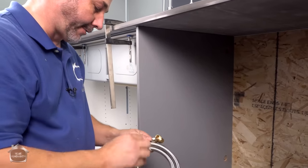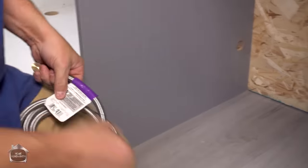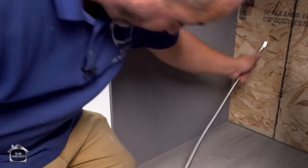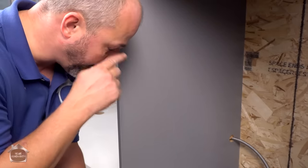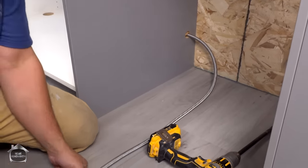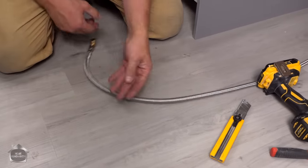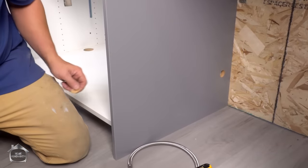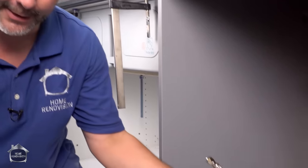Okay, so let's separate the wheat from the chaff here. I'm not a big fan of having stickers laying around, so there we go. Now, the trickiest part about this is that the hose goes through the hole at the bottom of the cabinet and connects to a water shutoff valve just on the other side. The hose itself is only so long, and the dishwasher has a track system — but this doesn't want to play ball. So what you want to do is drill your hole a little bit bigger than you need — I want an inch and a quarter — and I'm actually going to tape a line to this so I can pull it through after. That way I can set this under the dishwasher without any difficulty.